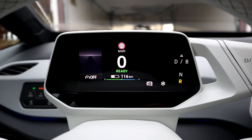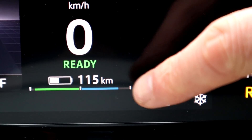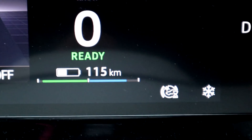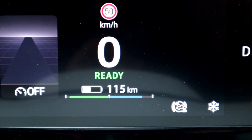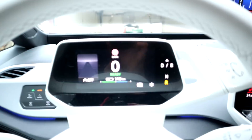Other cars have the same sound too. I've noticed it in the Model 3 — it's very famous for that — and also in the Hyundai IONIQ facelift. I was going down a long hill, a few kilometers downhill with regen, heated up the battery, and then it made the clunk sound. What you also get from a cold battery is you don't have full power and you don't have full regen. If it were zero degrees or colder, it would be even less regen and less power.